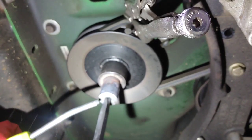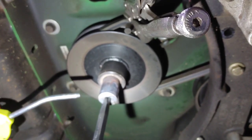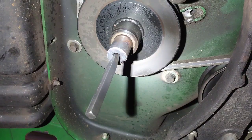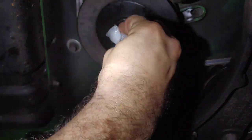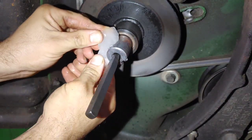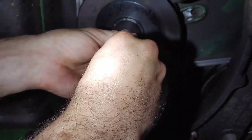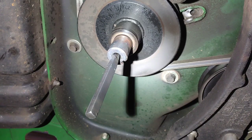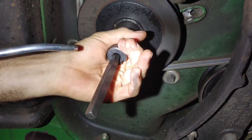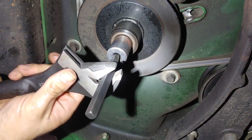There's a little bit of moisture coming out through our compressor, which only kind of helps in this situation. I'm just trying to quickly cool off that crankshaft that I just heated up. Now that I've got that crankshaft relatively cooled off — it's still hot to the touch — I'm going to take a piece of ice to rapidly cool down this end of the crankshaft. What this does is I've expanded and now I'm contracting, breaking the force between those female and male threads of that bolt, using compressed air and ice to break up that rust and corrosion between those threads.